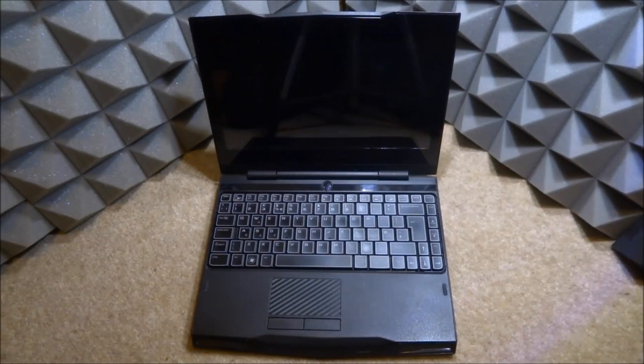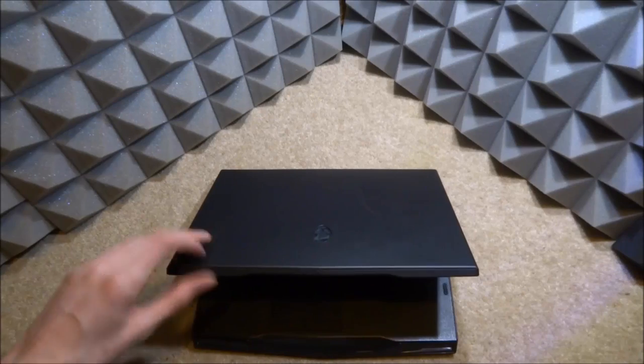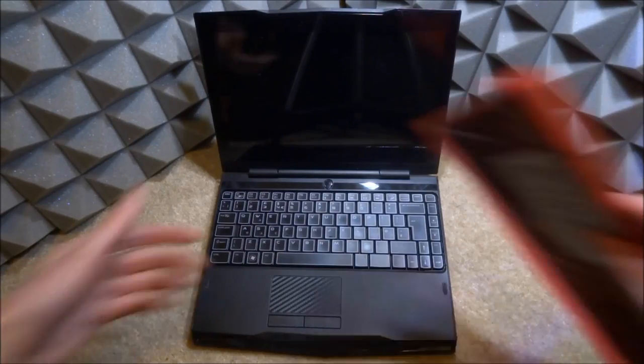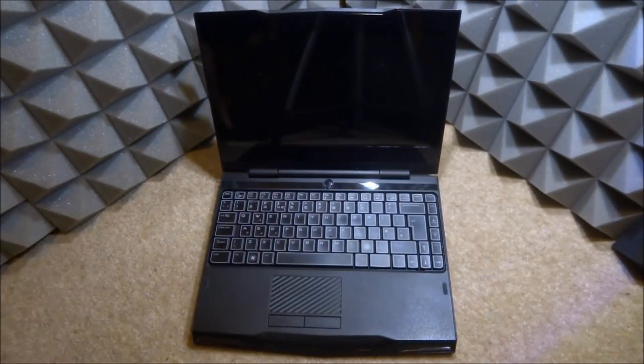What is up guys, Tech James here. In this video I'm going to be restoring my Alienware M11x R3 gaming laptop — they also call this the gaming netbook, so it is quite small. I picked this thing up maybe two to three years ago and it was very cheap. This laptop is very old but we paid about 50 to 60 pounds for it. As of now I can't even use it — there is quite a big problem. When I power it on it basically gets stuck and starts beeping incredibly loud. I've looked online and apparently the fix is to replace the keyboard, as the keyboards on these can get stuck keys or short out the whole laptop.